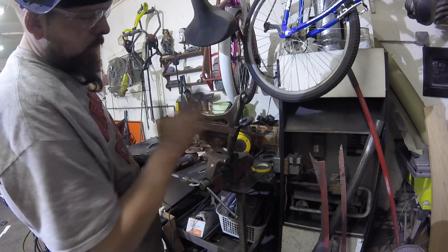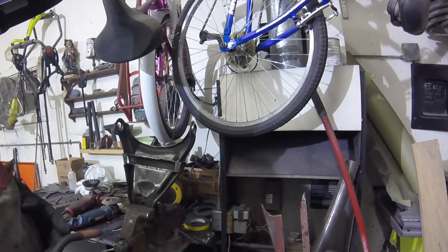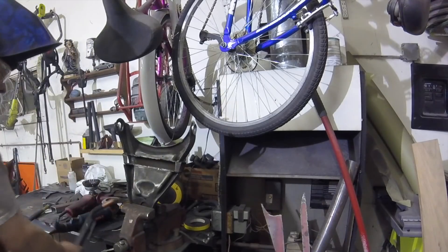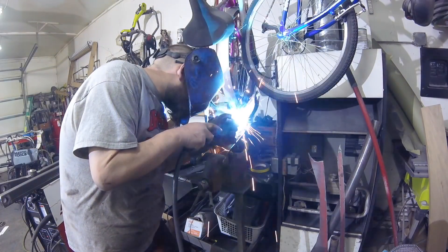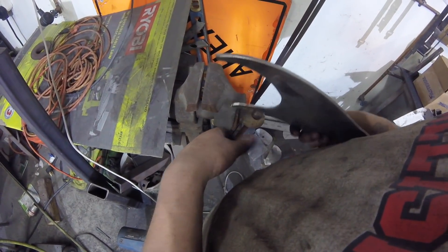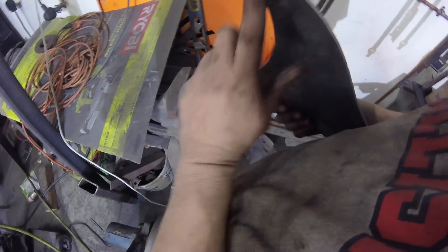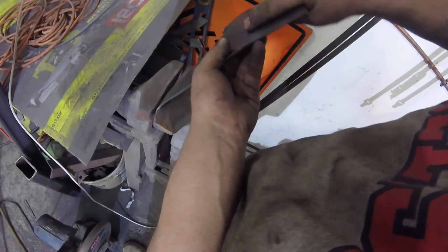I'm going to take a cutoff wheel again, which I absolutely hate, and hack those off to get them a little more flush inside. Now that I've got my tube cut out, I'll throw a couple of tack welds down here after I turn on my welder. Now I'm going to start with the top plate. Quick tip: you want to put a little bit of a curve on it before you start putting it on there. You can press it down on top of your A-arm to shape it, but it helps to put a little curve in first using a vice — just open it up a bit, put the lip in, and bend it down, walk it around.